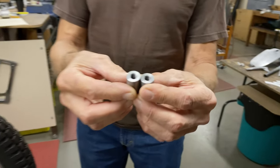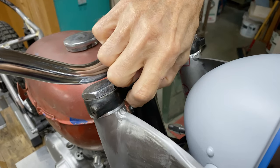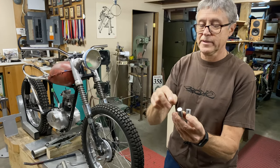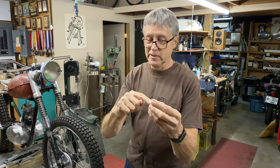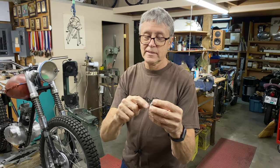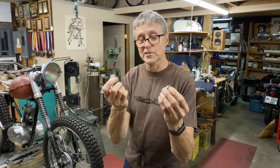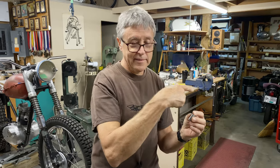This is what I made. It's going to screw onto the Allen screw. In the lathe right now we're going to round the end and put a dome on there. They'll sit like that, and the plate will be mitered with a 5/8 end mill — because that's what these are, 5/8. Then it gets a TIG tack and silver soldered. So we've got a little bit of welding to do today.